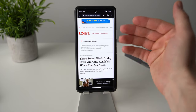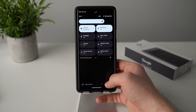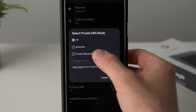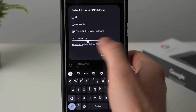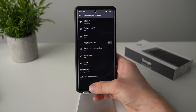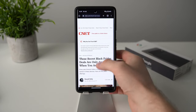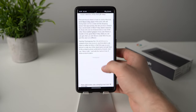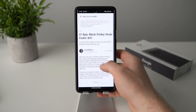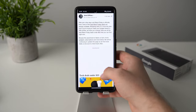You can actually block all of these ads system-wide across all browsers and apps. Go into phone settings, tap on network and internet, go to private DNS, tap on private DNS provider hostname, and type dns.adguard.com, then hit save. This creates a system-wide block on the majority of ads. Going back to the browser and refreshing the page, you can see the ads are blocked — just white space where the advertisement was, no pop-up videos, and anywhere there was an ad you just see the word 'advertisement' without the actual ad.